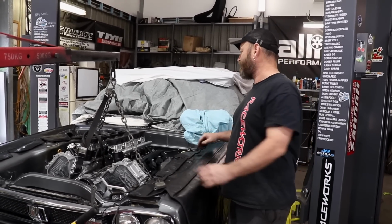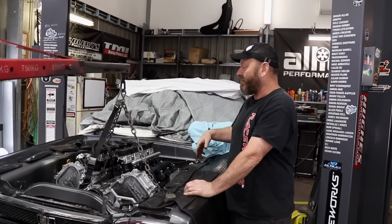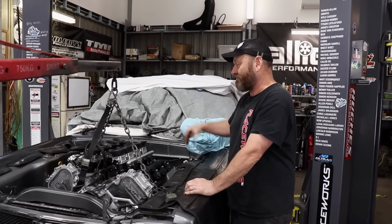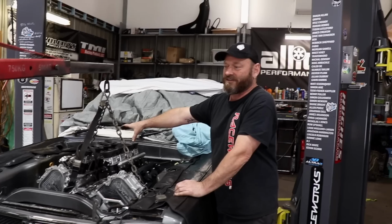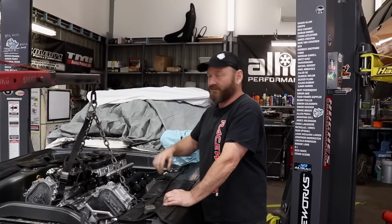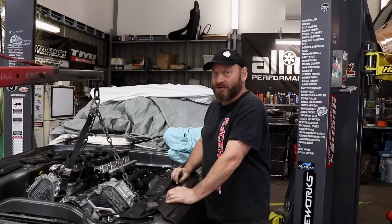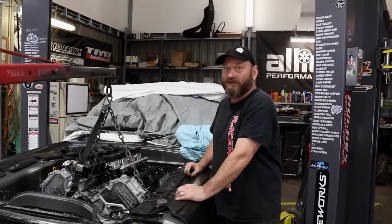the clutch master cylinder. The clutch master cylinder will probably just go over the top of the valve cover or the cam covers after we get it in there, but at the moment it's just stopping it from going down. The steering box is potentially an issue, mainly for header clearance later on. So we are investigating steering rack conversions right now. I've been Googling my eyeballs out, but we just want to chuck it in and have a bit of quick look around and see what's what.